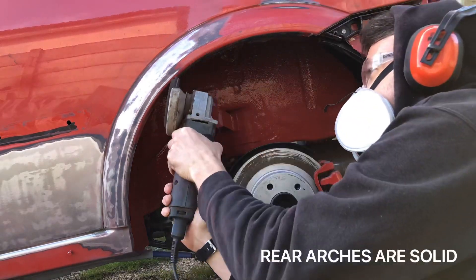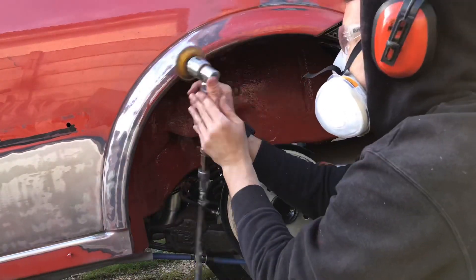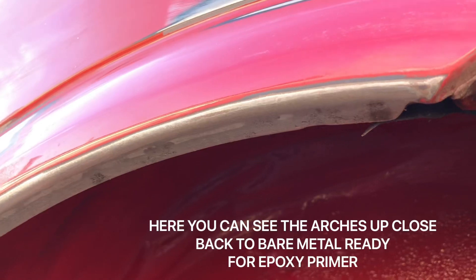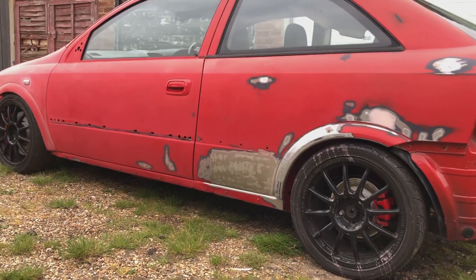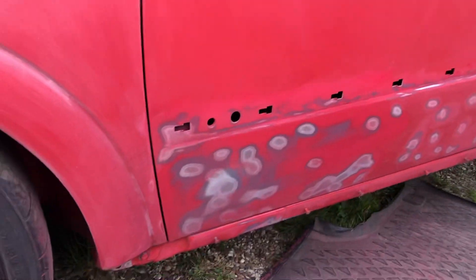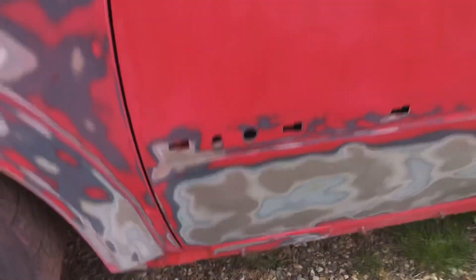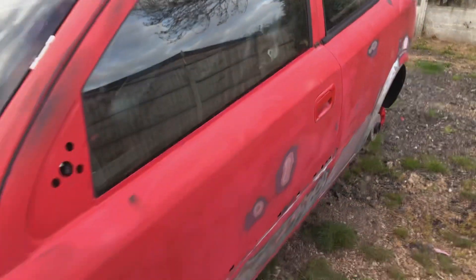On this car the rear arches are actually totally rust free with no corrosion at all, but I decided to strip them back so I could put an epoxy primer protection over them to protect them for another 20 years. Here's a close-up view of the arches — once stripped back to bare metal there's no rust or rot. I went over the whole bodywork with a grey scuff pad. Looking up close I'm finding more and more stone chips with tiny rust blisters underneath the paint, so I've gone back to fresh metal on those. The front wing had been painted in the past and done badly, so I got rid of all that paint to avoid any reactions.